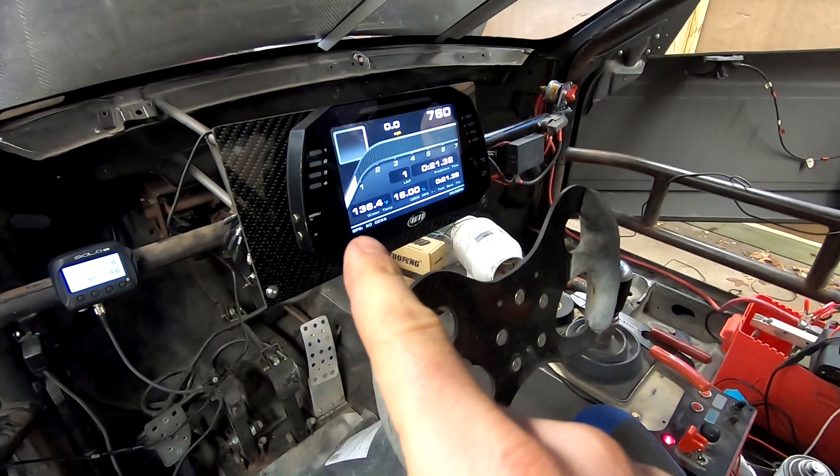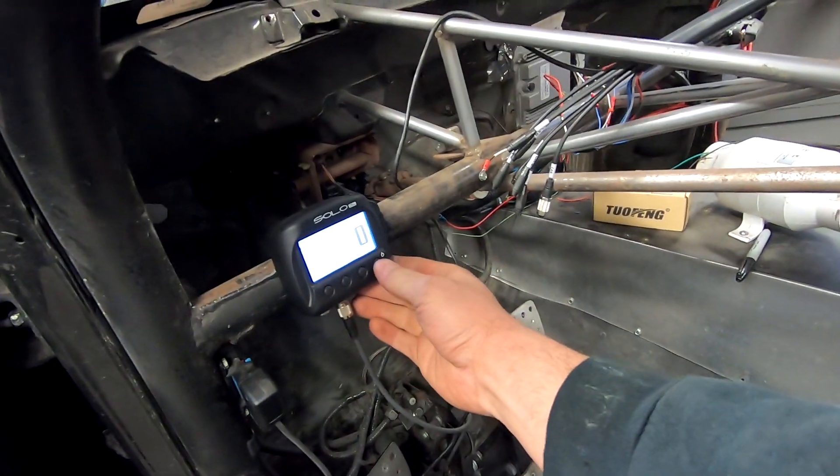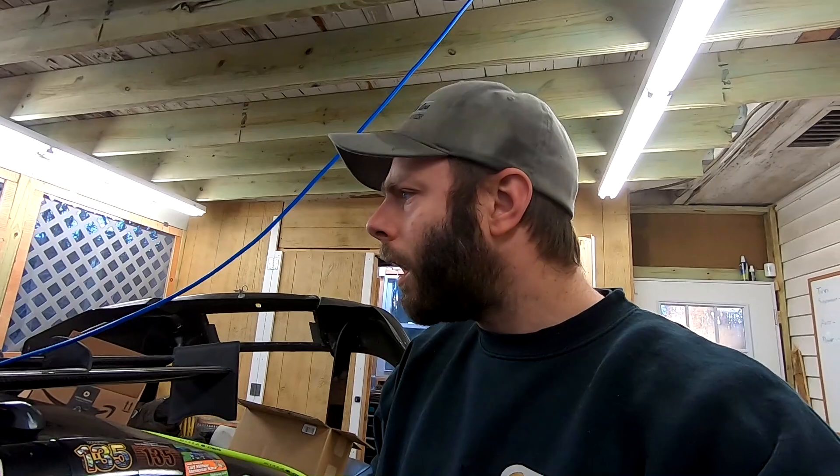Everything's kind of hooked up and working. You can see we have the water temp right there — right now I have that set for pedal position because I don't have any other sensors hooked up; it's just giving me what the OBD-2 gives me. Engine coolant temp 138, RPM 740-750 — so everything's working. I had to use a basic OBD-2 configuration on this because even though it's a Bosch computer, being an EcoBoost swap from an F-150 with a Ford Racing computer hooked up to an AIM system, stuff's getting a little bit tricky.